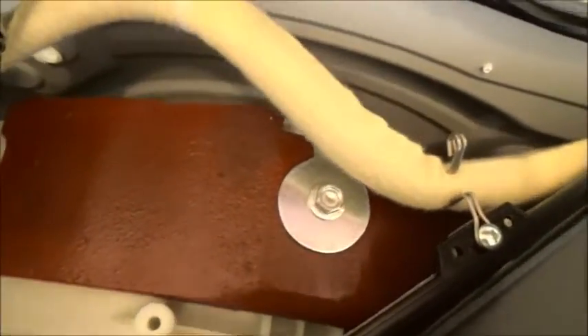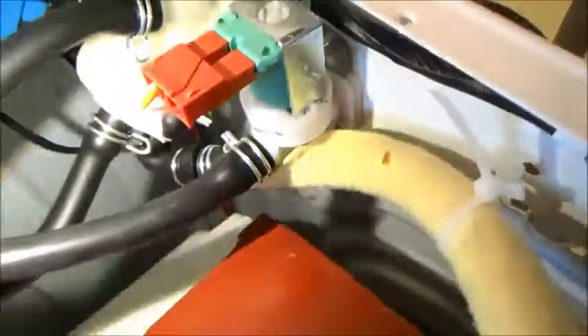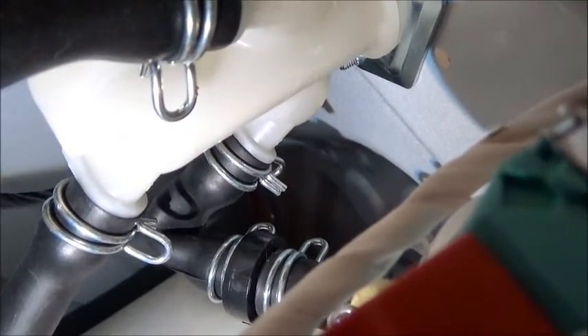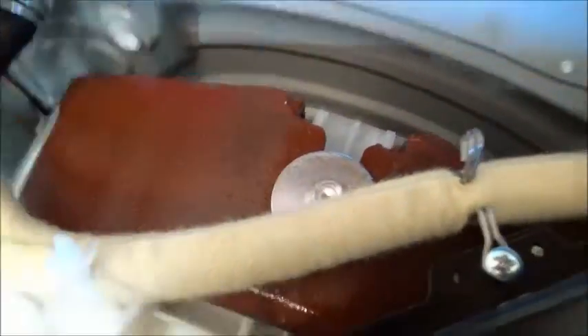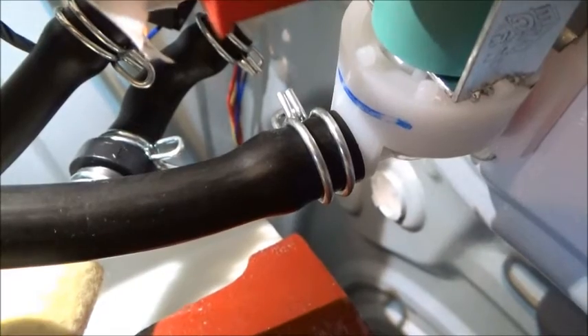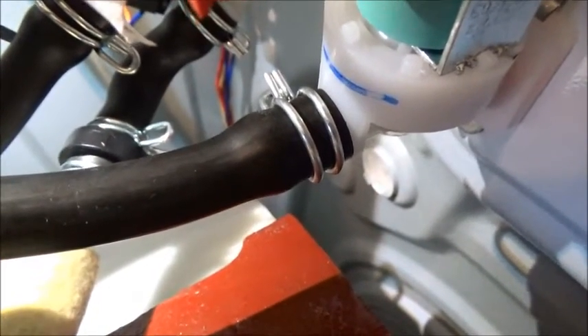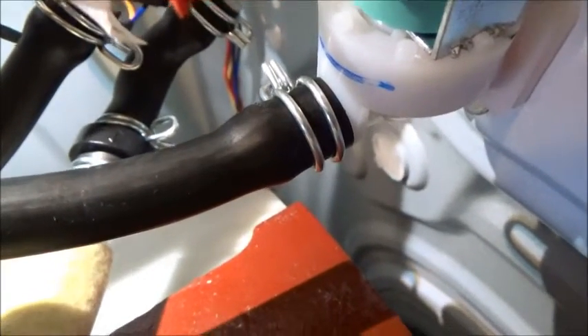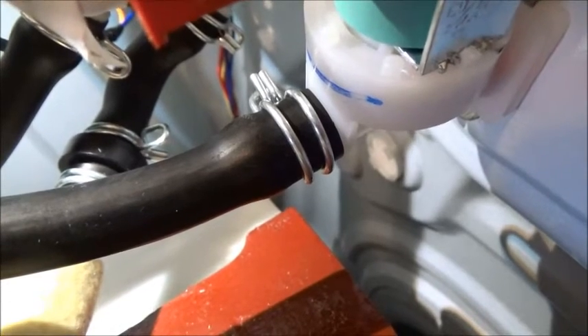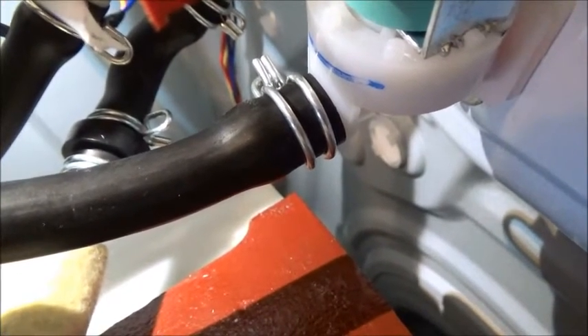Let me use my cell phone light to brighten it up a little bit so you can get a better look. You can see that kink. All I did was take it off the back of the unit and bring it out here so that it has a nice smooth curve, and you can see that the kink disappeared. After that I ran a load of clothes through it — wash and dry — and they came out perfect. I'm not sure exactly what effect that has since it's plumbed into the cold water inlet, which is kind of weird — you'd think blocking the water would make things really dry, but that's not the case.